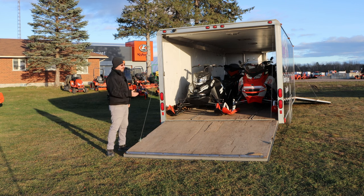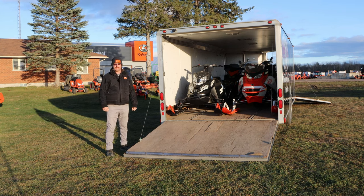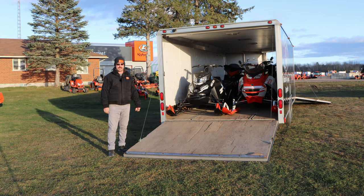So the disadvantage, of course, is the 8.5 wide. That's the max width that you're pulling, with aerodynamics and wind drag, so that is the big disadvantage. You are gonna need towing mirrors. Towing mirrors are gonna be necessary to see behind you with this size trailer. At 7, 7.5 wide, you got away with your regular mirror, without your extended towing mirrors, and still could see behind you and know what's coming up. So that's the pros and the cons of the 8.5 by 24.